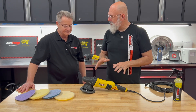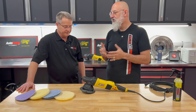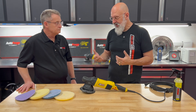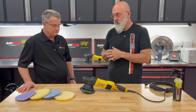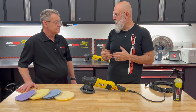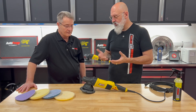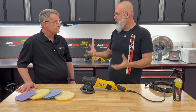Sure, I'll be answering as well. But the 25mm polisher is a little different in the industry. Normally people are stopping at 21mm — we went to 25. The reason for going to 25 is we always teach to cut with your dual action machine. A wool pad on the dual action is going to give you a phenomenal cut, but the longer the stroke, the better the cut. And 25 was a nice balance — we could have gone to 30mm, but then we're getting into territory where it's hard on the bearings, hard on the machine, and it can induce vibration if your pad isn't properly balanced. With the 25mm stroke, the balance is good. You can use just about any pad on it and we have enough aggressivity to give a nice cut, but not so aggressive that you won't have a nice finish.